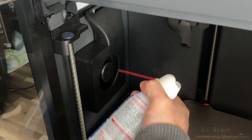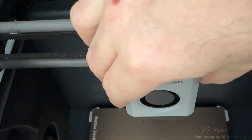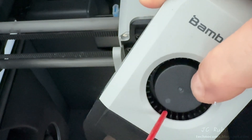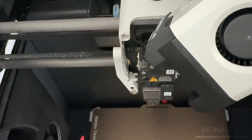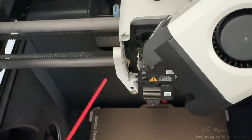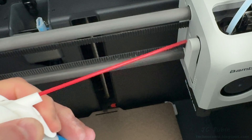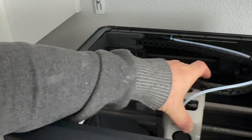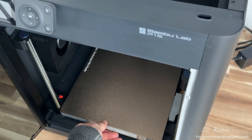With room now available I use a canned air bottle to clean out the fan. I can also remove the front cover for any dust or debris lodged in there. I blow out the rest of the printhead as well as the extruder. Finally I hit the pulleys over here to blow out any dust that might accumulate, as well as the one on the other side.